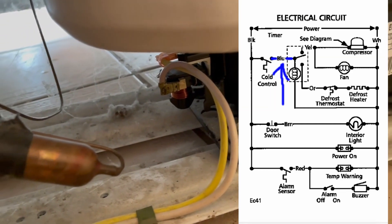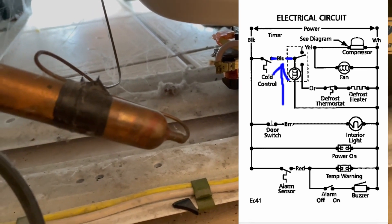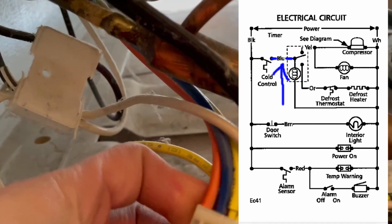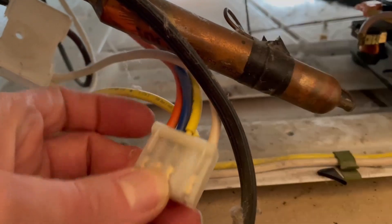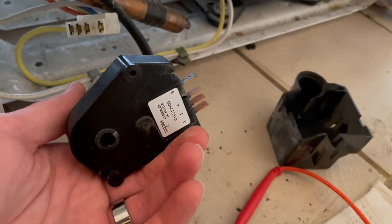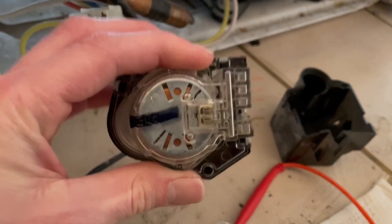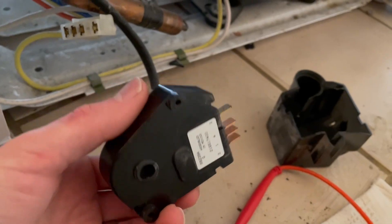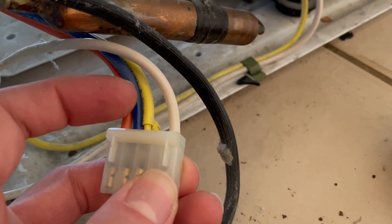Next I looked at the wiring diagram. The thermostat inside feeds this blue wire, which should be hot whenever the thermostat is calling for cooling. This plugs into the defrost timer. When I first saw the timer I thought it would be unrelated to the compressor turning on, but actually the power does flow through the timer for the compressor to turn on and cool everything. So this is a potentially bad piece. The yellow and white wires don't have power, and that yellow wire will only get power if the defrost timer connects the blue and the yellow.